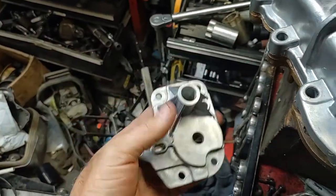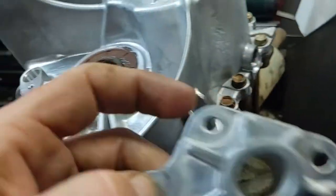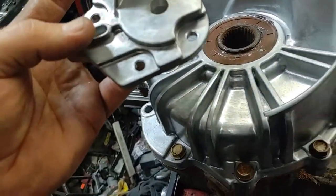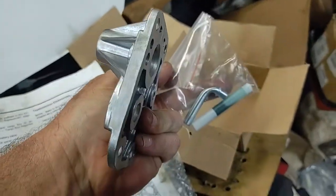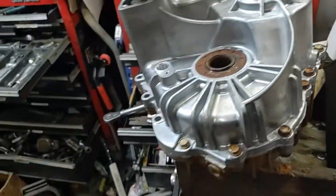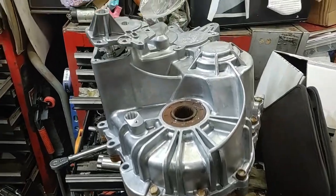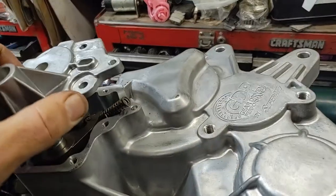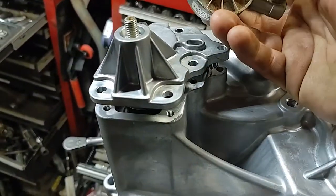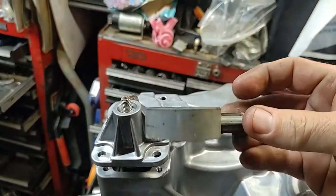In this case, it actually came with a new cover. I do need to put the little vent cap thing and the vent elbow on - it came with that too. I still haven't put my sensor in or the drain plug, but I've got to get that. Then we'll stick this back on the razor and should be good to go. I also forgot - I do have one more sensor to put on here for the shifter. The shifter sensor has a washer on this side, a washer on the top side, and this little part here goes in that little slot. That's all you have to do to put it back on.